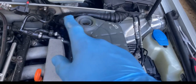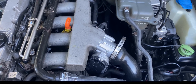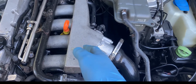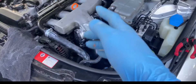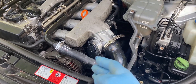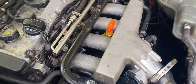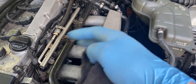We're going to finish filling the system because after I had gotten the thermostat on, I had to take everything back off because I found where the actual leak was that made the original person working on it think the thermostat was bad. That's why he wanted to change the thermostat — because he thought that was leaking. But there's actually, on these, a little plug that sits behind the thermostat and you can't get to it unless you take everything off and go behind the thermostat.